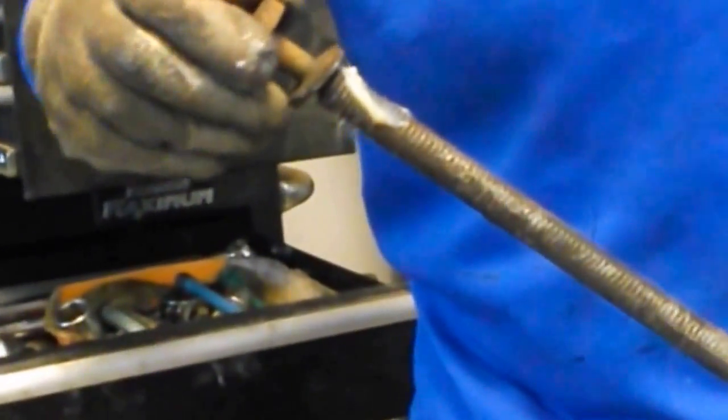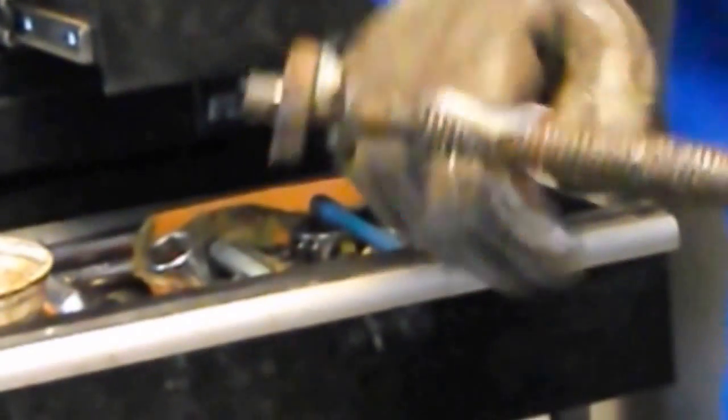That's really quite well coated — a little bit up there at the top too. The other thing you want to do is make sure all the washers at the top of the shaft are really well greased as well, because they actually spin. When you're cranking the handle, these things spin on the top of the shaft, and if they're not lubricated it just makes it really hard to turn.